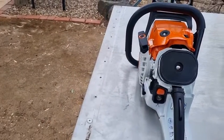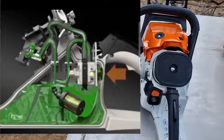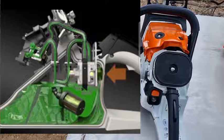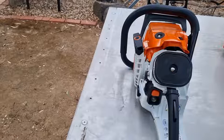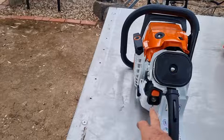Have a look at the picture up the top there — there's a diagram showing the internal workings. When you pump the priming bulb, the fuel flows around the lines and primes the injector with a bit of fuel. If you keep pushing it, it sends fuel back to the tank. So every time you start the saw, you're supposed to push it about eight times. I've noticed that if you stop using the saw for five minutes, you might only need to push it once or twice, but if you haven't used it for an hour, you'll need to push it about seven or eight times again.